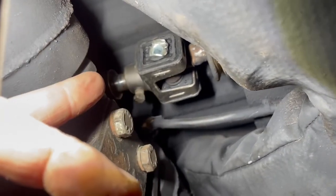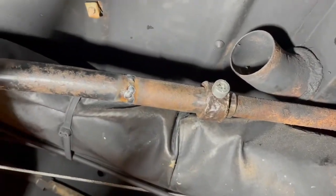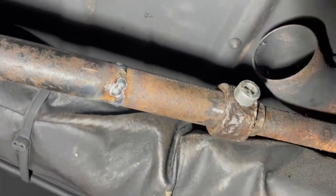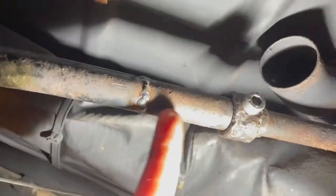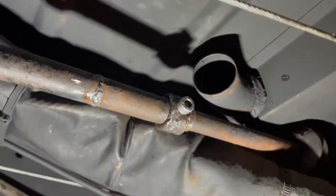This bit you have to find room for another place, and I did it at this end. Instead of making my shift linkage longer in the back, I just extended the shift linkage in the front by about 10–15 millimeters. It looks a bit weird being offset like this, but that's just because I don't want a weld inside where I have my pin for the rear. So extend this one, keep it with the stock shift linkage in the back, and you're good.